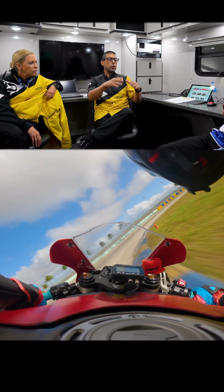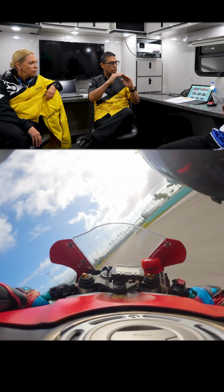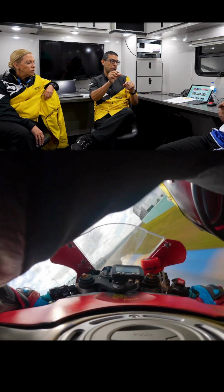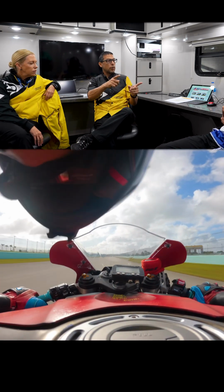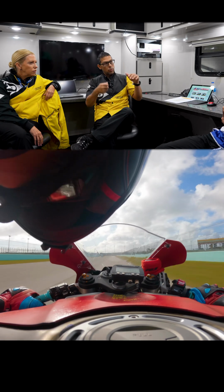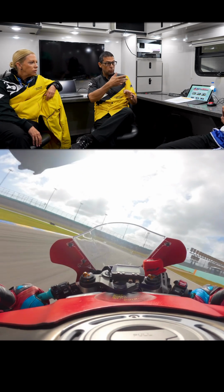So what we understand is, we put more pressure in, that narrows the contact patch. You're still going to get that cold tear and graining, but it's going to be much smaller and narrower. It's not going to actually take chunks out. If you go less pressure, now that thing gets wider and starts to get even worse. And you can't roll the corner. The drive grip is still there, but you can't roll turn 2 or roll the corner anymore.